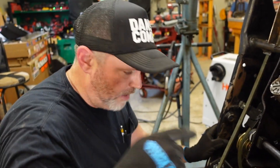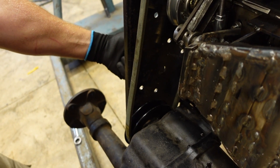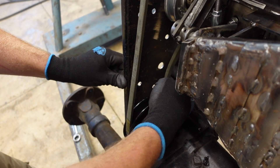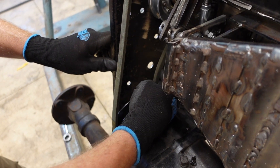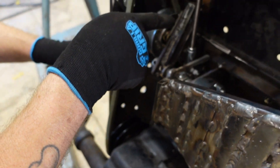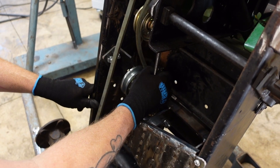If you look down right in here, I had an idler pulley right here - my finger is in this big 5/8ths hole - and it was pulling tension, wrapping the belt more around the transmission pulley like this. It ain't there right now because I've been fabricating. I liked it well enough. Come back up and look at this now - here's my idler pulley arm that's under spring tension normally.